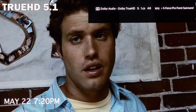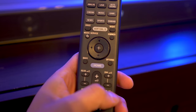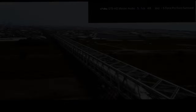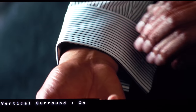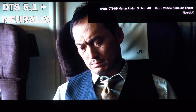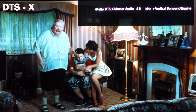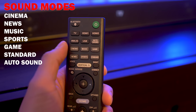Those clips were in Atmos, and when you play non-Atmos content like Cloverfield, you can hit the Vertical Surround button on the remote and it will use the Dolby Surround upmixer to give you simulated height channels. Hitting the display button will tell you what format is playing. The same applies to DTS — using the vertical surround option will use Neural X processing to add height effects. The soundbar also supports DTS:X, and there are seven different sound modes you can select depending on your preference.